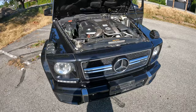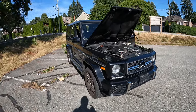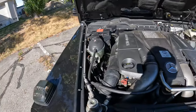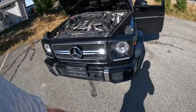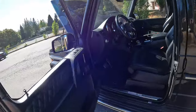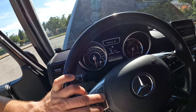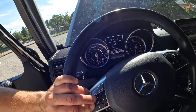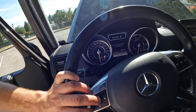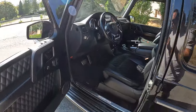This being the G63, it's got the 560-horsepower engine. It is pretty noisy, and I noticed it comes up with a message saying the service is exceeded by about 20,000 kilometers — that's probably not good. I can see service A exceeded by 22,000 kilometers, so I'm guessing it probably needs an oil change.